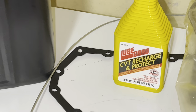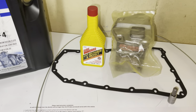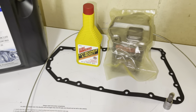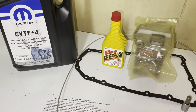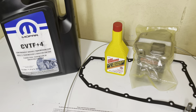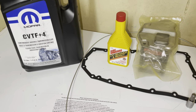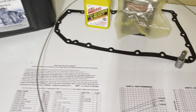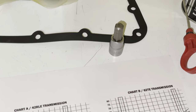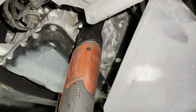225,000 miles — this thing has done great. You need the filters. There are two filters on this transmission, and this may apply to many other transmissions — we'll list all the vehicles in the description. The first thing you want to do is get the car up on jack stands, get underneath it, and use a 10mm Allen to drain the fluid.